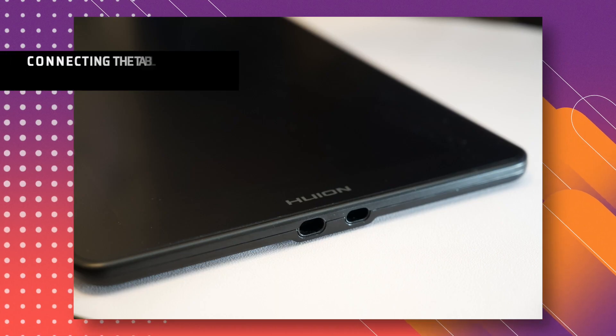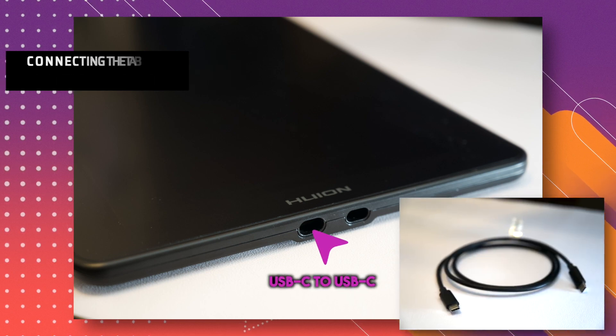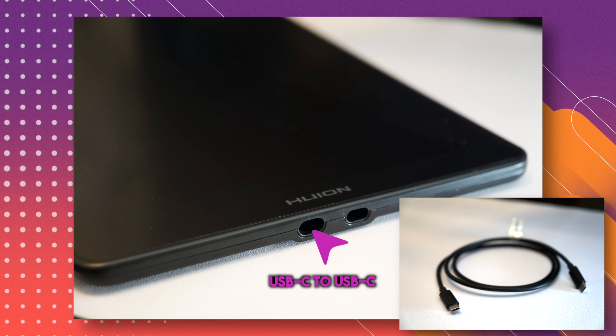The Canvas 13 has two USB Type-C ports. The bottom port is for a full-featured USB-C to USB-C single cable connection — this is the only cable you'll need if you have a computer with USB-C. The cable doesn't come with the tablet, so you'll need to purchase it separately. Make sure you get the right cable, since not all USB-C to USB-C cables will work, and this is actually quite a frustrating part about this tablet. The USB-C ports on the side are recessed in, so you need to ensure the cable has a very thin wrap around, otherwise it won't fit. So although I have a dozen USB-C cables, I can only use the one intended for this tablet. I'll put the link in the description below for the correct cable.